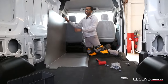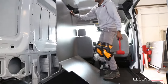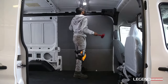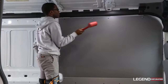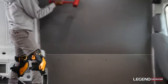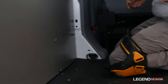Now I'm going to install the Transit Insulated Duratherm Wall Liner. What I'm going to do is put two plugs in the top. We have simple, easy push-in plugs which are really easy to do. Line it up to the contours of the vehicle and the holes, and just hammer them in. Make sure all your holes are lined up before you put your plugs in, or else they'll bend.